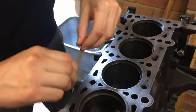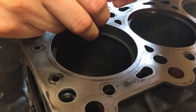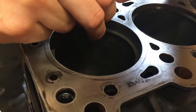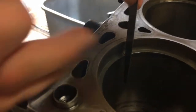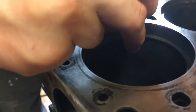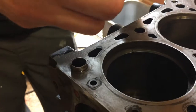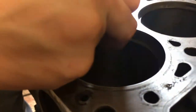And then using the feeler gauges, we'll check that we're actually at 17 thousandths. Alright, so 15. Yeah, goes in but easy. Can we get the extra 2 in there? Now, we shouldn't really sandwich 2 together because it's got to make it a little bit thicker.